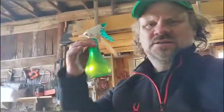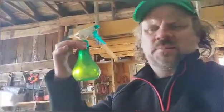These cars are old, and they've been on the road many miles, and a lot of things are rusted. And my little trick is diesel in a spray bottle. Have some patience, spray some diesel on it over the course of the day to get these nuts loosened up. Works great as a penetrant.